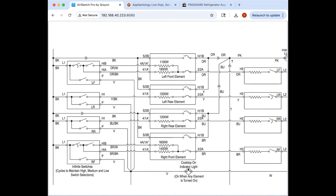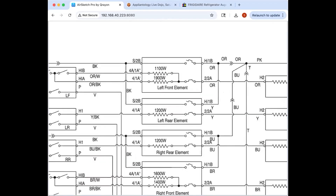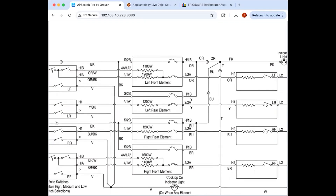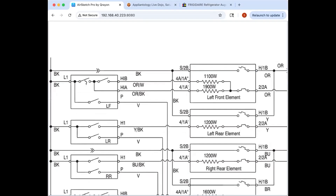Is it safe to say if you've got a thermal limiter that's not working you should replace the infinite switch also? Well, the thermal limiter is part of the element, not part of the infinite switch. The limiters are bimetal switches as well, so they're resettable. I believe the way some cooktops achieve the highest heat setting is by mechanically locking the bimetal switch in the infinite switch — preventing it from ever opening — and then just cycling off the thermal limiter in the element.